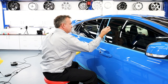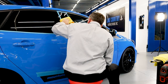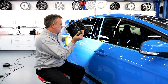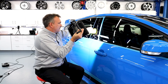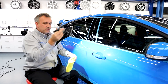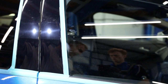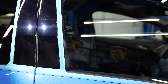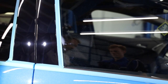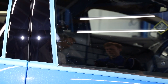I'm now going to wipe off the fine polish with a fresh cloth — the cloth used earlier removed the cutting compound in step one, so I don't want to use that same cloth now. Taking the tape off, carefully wipe that area down, flipping the cloth, and inspect it with the light. We've got some sticky marks from the masking tape — they'll come off with alcohol. There are a few bits of fluff and lint from the cloth. Bringing the camera in: we've got the swirls from when the vehicle came in, then there's the first stage cutting with the blue HDO pad, then we've gone from the blue pad to the finishing black HDO pad — Oberk step one and step two compound. You can see why we do two stages of refinement on piano black.